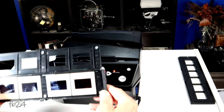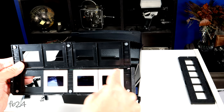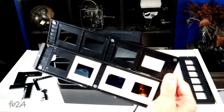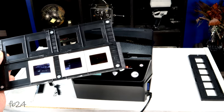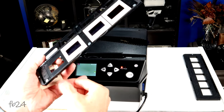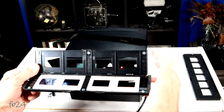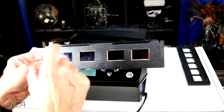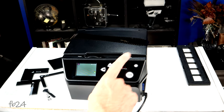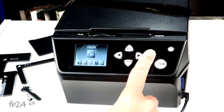These are very old slides that have turned bluish-purple, which happens with slides that are 55 or so years old. The last slide is a Christmas tree shot sideways — you scan it in that orientation and flip it later. Now make sure your slider is set to film since we're using the side slot. Go to the film menu and hit enter. There's no dedicated up/down — left and right cycle through everything: black and white, color positives (slides), and negatives (110 and 35mm). We have 35mm color slides, so select that option.